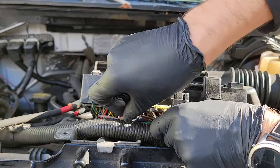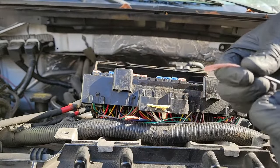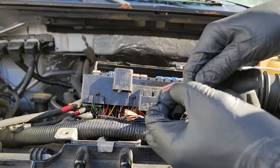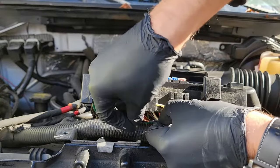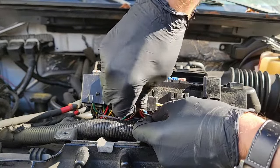If you just twist them around like this, they will come apart rather easily. That won't work for me. I want them to really intertwine with each other. So spread some of the core out on both the old and new wires. Then thread them through each other. Now you can twist them together and this should give you a really good connection.